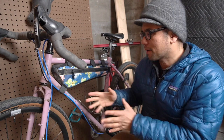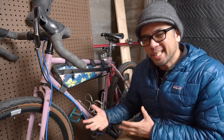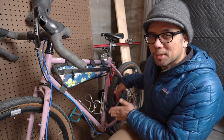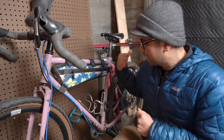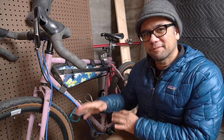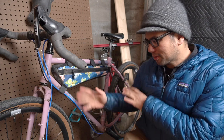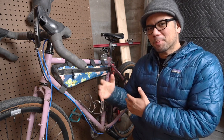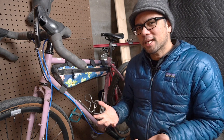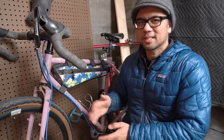Components and build aside, what really attracted me to this bike was the geometry and ride quality. When this bike first came out it was fairly unique geometrically. It has a relatively tucked rear end — the rear chainstay is 425mm — but it does have pretty good tire clearance. I've run up to 650b by 2.1s in here, and if you swap to a 26-inch wheel set you could fit 2.3-inch tires. Another thing I liked about the ride is the slightly higher trail on this bike, which was more of a solution to try and solve toe overlap.